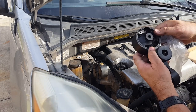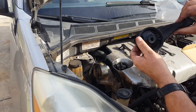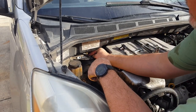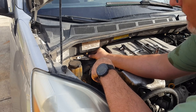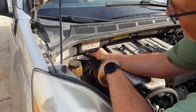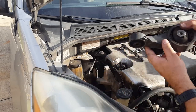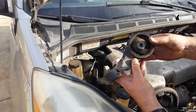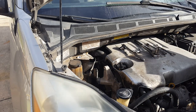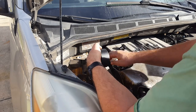There's the new one. As you saw in the video, this portion here is busted pretty bad - it shifts every time you put it in park or whatever. Once you get it broke free you can get this one off with your fingers, just get it broke free with your ratchet. There we go - so there's that one, and this right here is cracked. It was shifting all the way forward. Get rid of that and put the new one in.